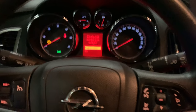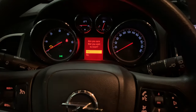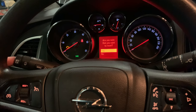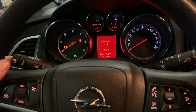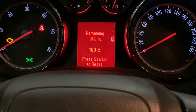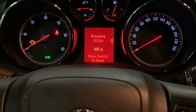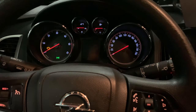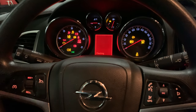Turn to 'Yes' like this. Once you have done that, confirm with the Set and Clear button again. As you can see, the remaining oil life turns to 100%.